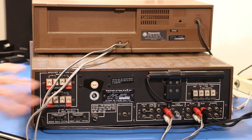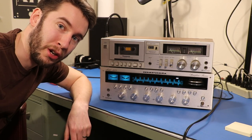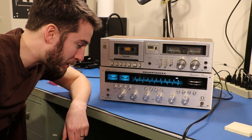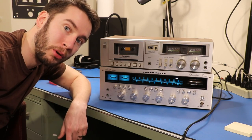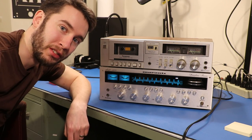This is how you get audio from a modern smartphone onto this. And of course hook up your speakers — I'm gonna do that off camera. Basically what I've just shown is you need a receiver with tape inputs and inputs for another source, a tape deck that can both playback and record, and a source — something you want to put onto your cassette tape.